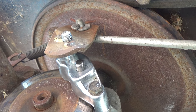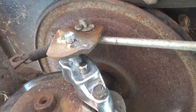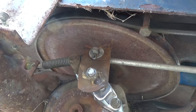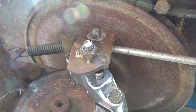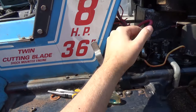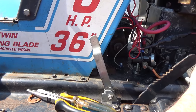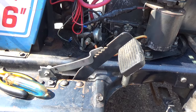How firm your brakes are is going to depend on how tight you put that first nut on. So with our first nut installed on the threaded rod, cleaning that threaded rod up with a wire wheel is kind of important because it makes re-threading that nut back on top a lot easier. Now come over to your brake lever and push on it all the way until the front position. On this one we have a little stopper so I can set the brake in the full position.